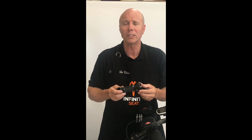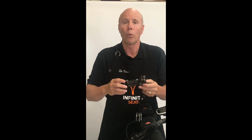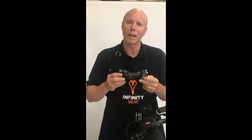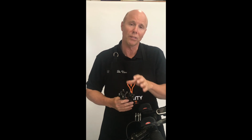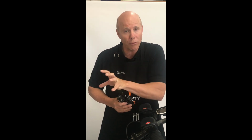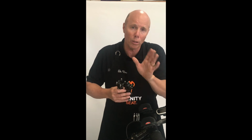As we get a little older, we're having some fun, but we're noticing some pressure in the neck. We might want to graduate to a little bit different stem that gives you a little bit more range of motion. If I'm not racing, I'm looking for more comfortable riding, we might need different degrees of stems. They even make an adjustable stem if you don't really know where you're at, or if you're recovering from an injury but you know that you're going to be eventually getting back to that. You could get an adjustable stem that allows you to start a little bit more soft, and as you start healing and progressing, you can work yourself down before you put your original stem on.